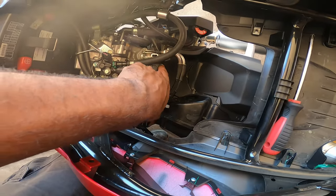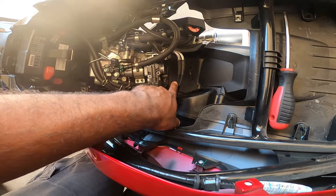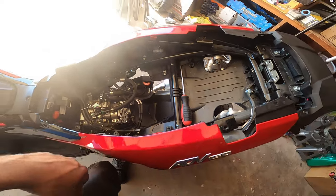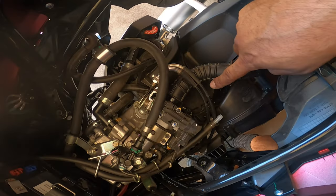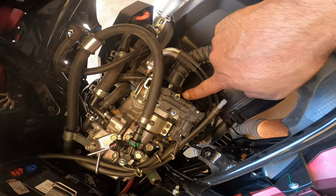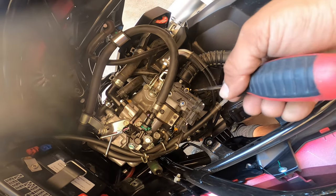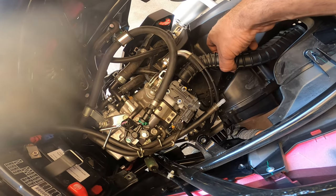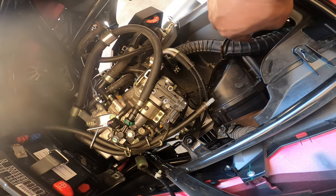Down here you should have a little clamp that holds the intake pipe to the throttle body right here. I'm going to bolt back in the factory one right now so you guys can see what I mean. The factory intake should be very close to this — it should snake into the actual intake box here. You'll see there's a Phillips screw right here at the top. All you're going to do is break that sucker loose counter-clockwise, wiggle it up and down, and yank it out. Once you do that, you've got to remove the air box with it all as one piece.